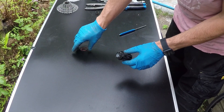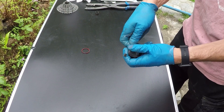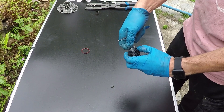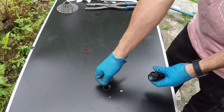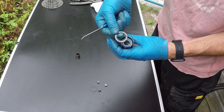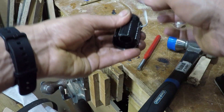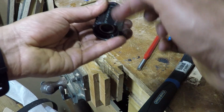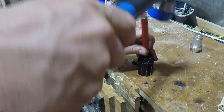To work on the free hub, put aside the red seal, noting the notch face of the free hub body. Then remove the wire clip holding in the pawls and the three pawls themselves. Pick out the black rubber seal covering the outside bearing. Next remove the small grub screw which holds the inside bearing in place with an allen key. There are two 6902 bearings in the free hub body, separated by a spacer.